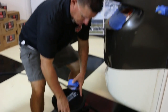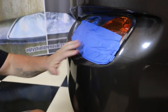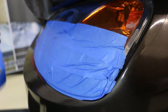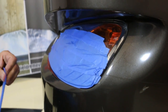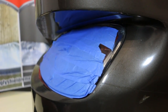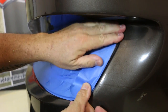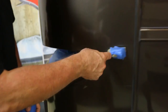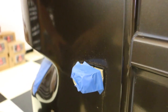Our trusty stool helps us in the step of taping the headlights. I like to use the 3M Painter's Tape, the wide, and the technique we're doing is taping from the bottom up so the solvent doesn't get behind the tape and possibly do any damage to the headlights. We tape them as a precaution — real simple, takes only a couple minutes, but boy does it save you trouble if you damage the headlights. We also make sure we get the cameras — they're very expensive, so we tape them too. That covers the prep work on the headlights, mirrors, and cameras.